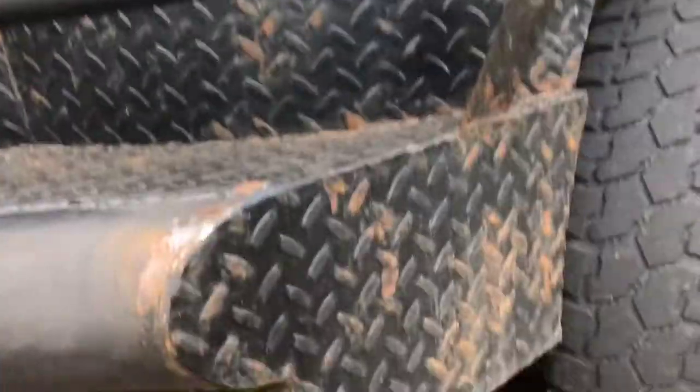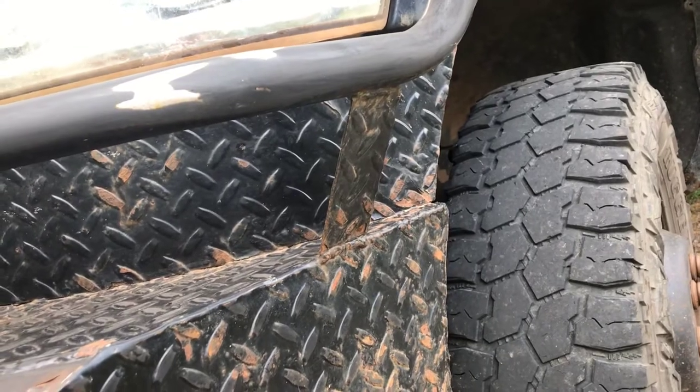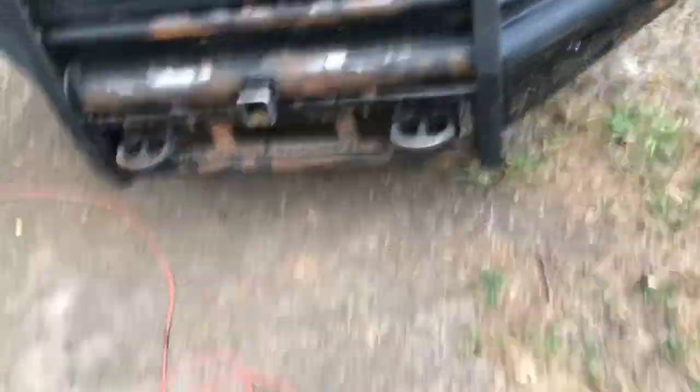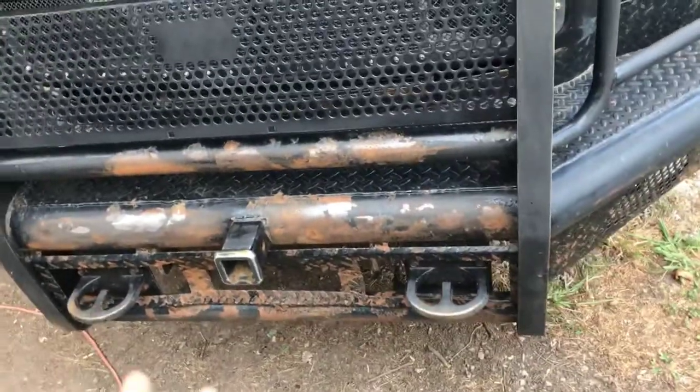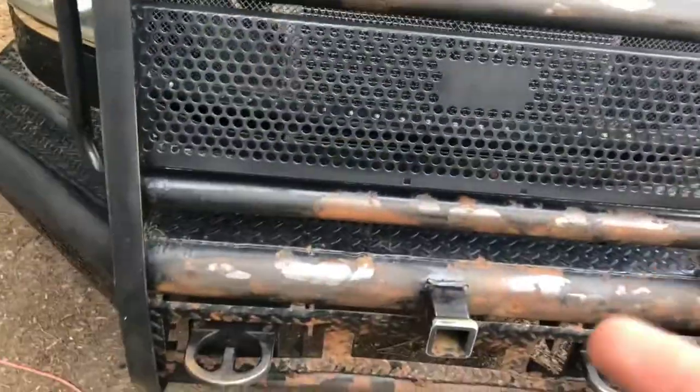We're finishing up really on the rebuild process of this brush guard. I didn't think you guys needed to sit there and watch every bit of the sanding that had to go down on this. Because if you guys have ever had one of these Ranch Hand bumpers, man, they're solid as a rock. But they are on the front of a truck, and if yours is kind of older like mine, they got rusted pretty quickly. The metal underneath is still good — it's just the paint was peeling over the top. So I had to take my sander and sand it all down anywhere that there's rust spots and get it down to surface.